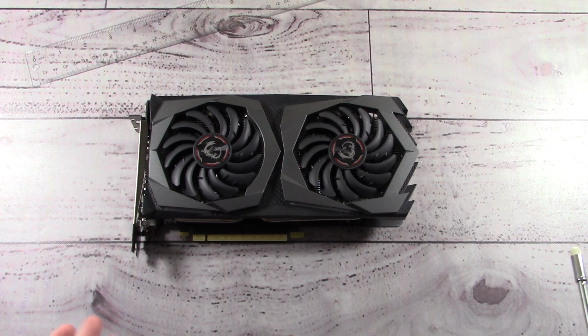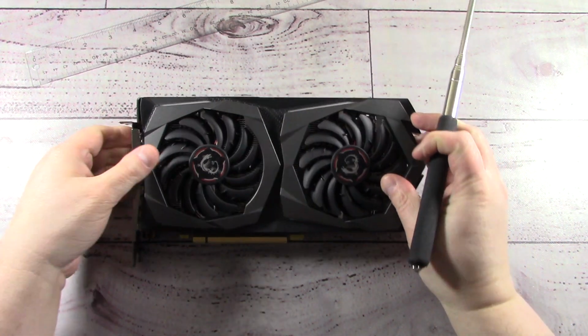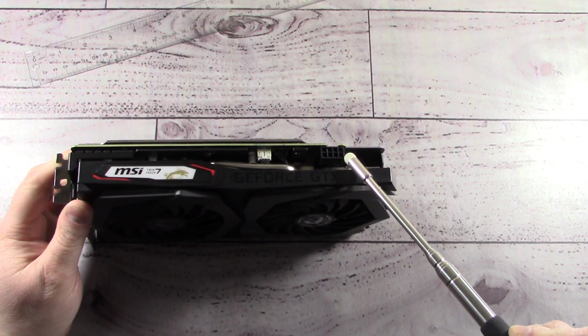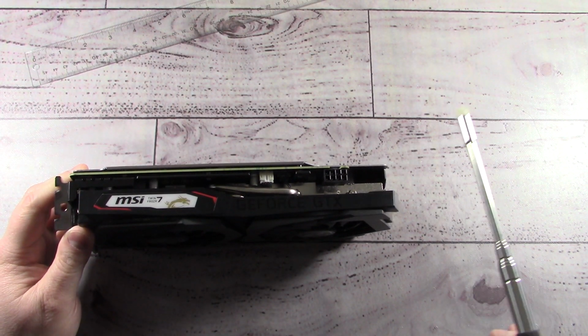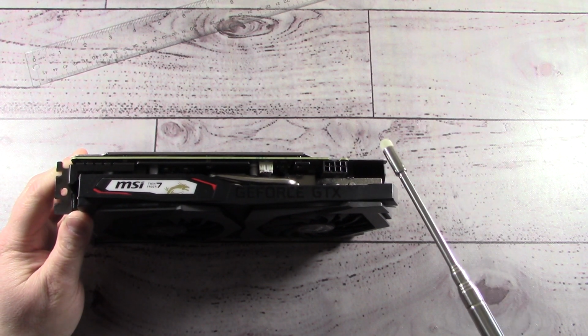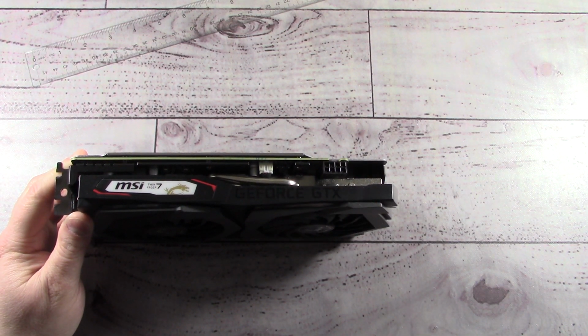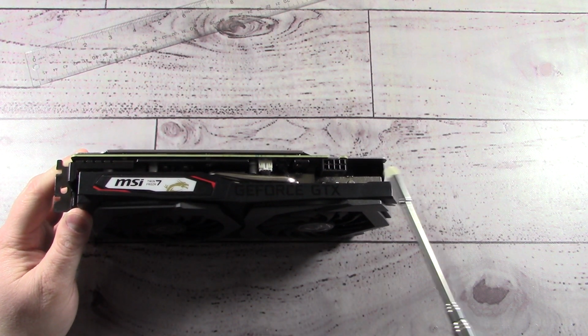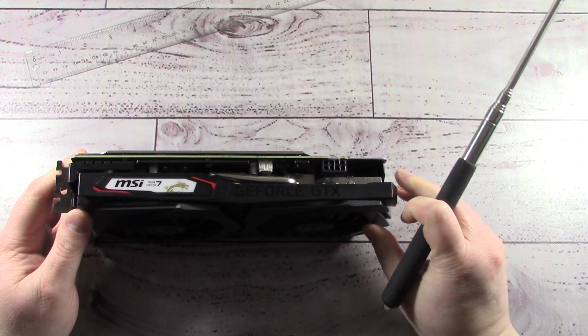The video card is rated at a power consumption of 125 watts and recommends a 450 watt power supply. And for this level of card, it does require an 8-pin power connector. So this is definitely going to require a little more juice, but that is to give it that higher and better and more stable overclocking ability there. So 8-pin power for this video card.